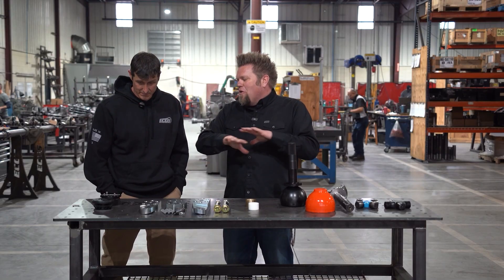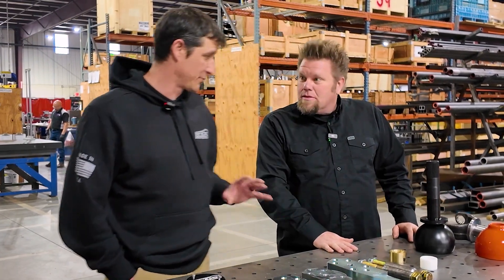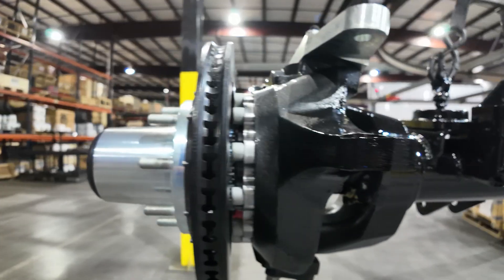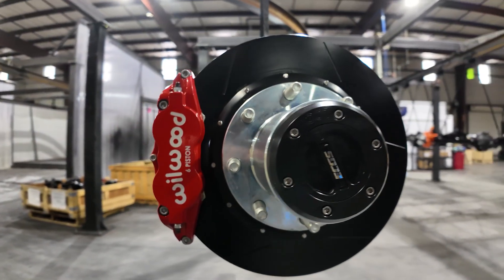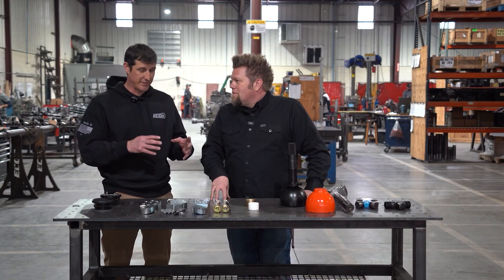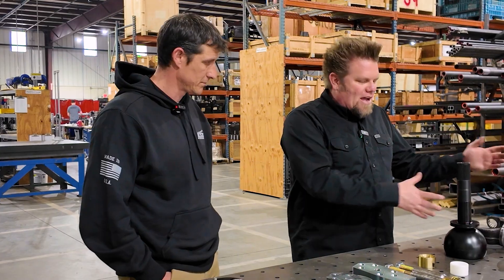That's probably in my mind one of the biggest differences between the KP540 and 05-and-up. You get the extra length here, so you've got some torsional twist when you shock load it, which helps tremendously. And in my opinion, if you run the lockouts, you have a failure point that's the outermost. This lockout is extremely strong — as strong as anything on the market — but when you mix this stuff together and you've got a big center section, something has to break and it will transfer out here. So those are your options when it comes to axle shafts and lockouts.